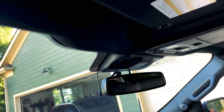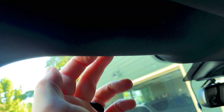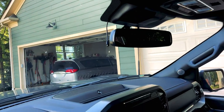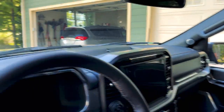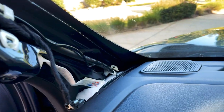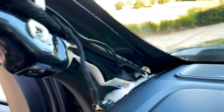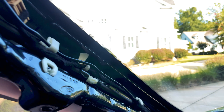I didn't feel like going through the whole process of removing the headliner, but if you reach your fingers up in there, you can get it down just enough — and be careful not to crease it — so you can slide the wire in. There's a little lip behind there you can feel with your fingers, so strongly advise making sure you get your wire over that hump so it's not going to flop down on you. What's cool is there are already nice little factory clips for wiring, so I just popped my USB cable into those clips.